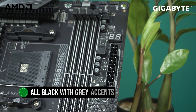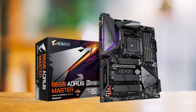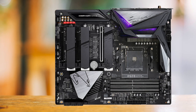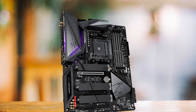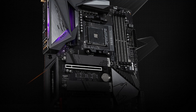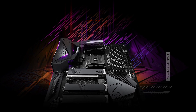The board is mostly all black with gray accents. All three M.2 slots feature heatsinks with a line pattern design that runs from the rear panel cover through the heatsinks. The rear panel cover also sports some subtle RGB lighting. This I/O shroud blends in with the gigantic VRM heatsinks covering the 16-phase delivery system — 14 of those digital phases are dedicated to the V-Core, meaning you can get superb performance out of nearly any Ryzen processor. This 16-phase power delivery also allows for excellent CPU overclocking. Memory overclocking is quite impressive as well — you can crank DDR4 kits all the way up to 5200 MHz, provided you find the right RAM kit.